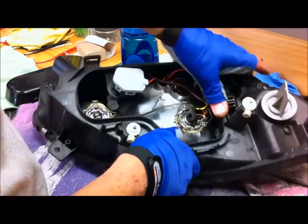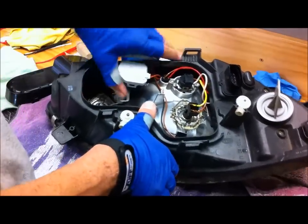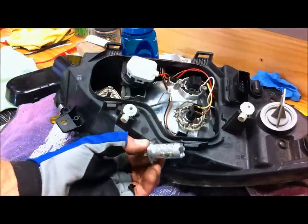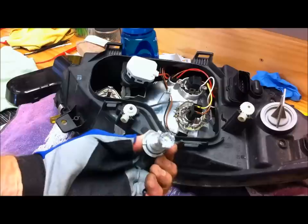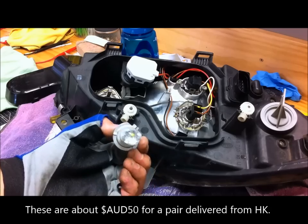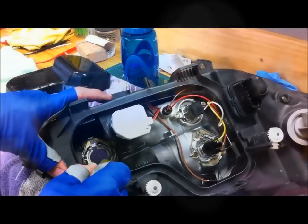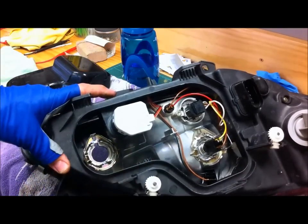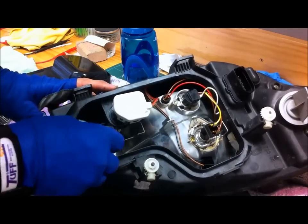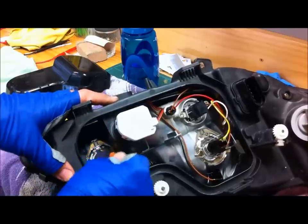That's the one I want to work on, so I'll take that off. So there's my fancy Cree LED projector bulb — there's a projector lens in the front there and that was being covered by the cap. It's quite easy to get the cap out. All you have to do is this ring fitting here — you just prise it off. It's held on by little tags there. You can just lever it up upwards — you can hear it clicking.